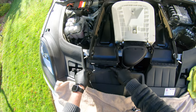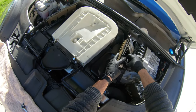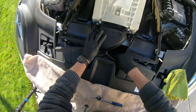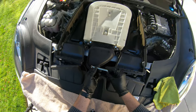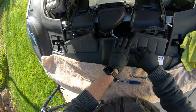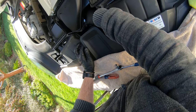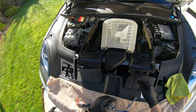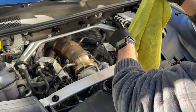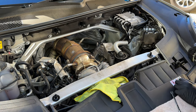To remove the air box, first remove both rubber air intake scoops by sliding them forward — they come off easily. You'll also need to remove the oil filler neck by pushing in on the clip and sliding it out of the way. Then loosen the air intake hose using a 7 millimeter metric wrench. Try to use a wrench rather than a socket as there's not much space and stripping it will cause problems. If the air intake neck doesn't come off easily, loosen the hose clamp more and slide it left and right while yanking. If needed, carefully pry it with a large flathead screwdriver. Now lift up and forward to remove the air box and set it aside. Cover your air intake with a rag so no dirt or foreign objects can fall inside.